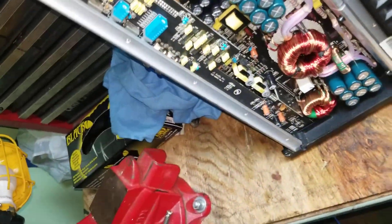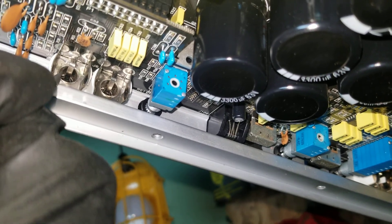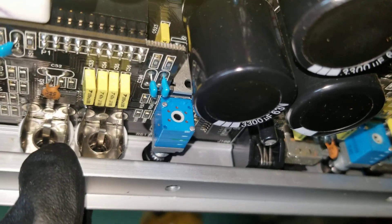Here's the back panel — it's just a flat piece of metal. The front panel does not come off. Now, the problem is the contacts at the audio input where the RCA cables from the head unit connect to the amp. There are little metal contacts that wrap around the RCA cables barrel-style. Over the years, from vibration of the bass or driving, they get a little too flexed out and lose contact with the RCA cables.